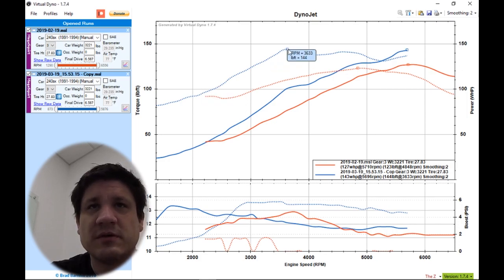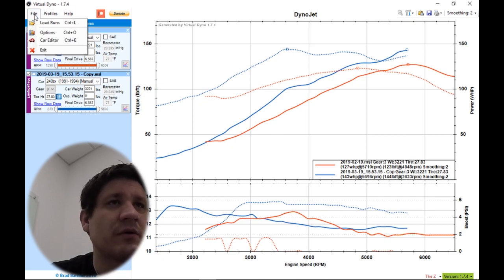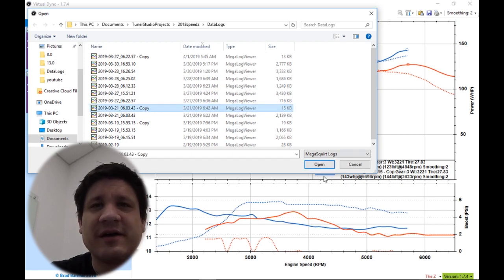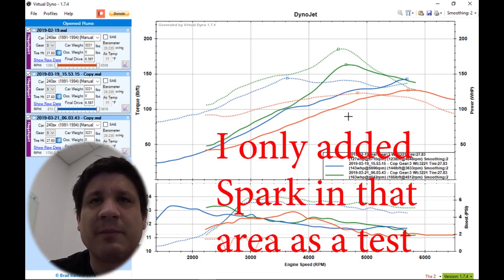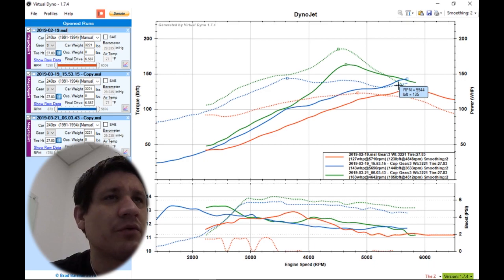You'll notice here — look at how the boost hits, kind of levels off and dips down. Part of the reason why is I was doing a lot of tuning; it wasn't quite where I needed everything to be and still had a lot to sort out. I then pushed the timing just a hair and it was actually kind of fun. I gave it a couple of degrees of timing but ended up backing off because when I pulled the plugs I wasn't very happy with it. You can see just look at how the horsepower just keeps going up. I did back off the throttle a little bit early, so that's part of the reason why it started dipping down and the boost started dropping off on that log.